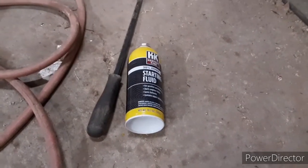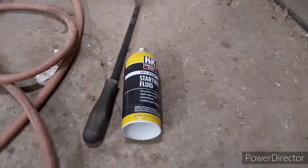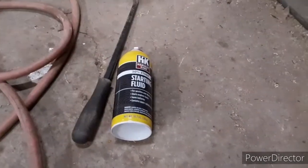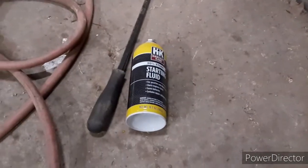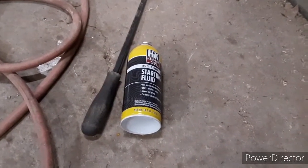So you don't want to let it burn too long. It doesn't really hurt the tire at all, unless you really start a tire fire, you know. But getting that perfect pop, it usually takes a couple tries till you know the tire size. And see, I already went through the trial in there to get that size right, so that's how I knew it was about 3 seconds. But me counting anyways. Tractor tires usually a little more. You know, I've seen some 12, 15 seconds on tractor tire.